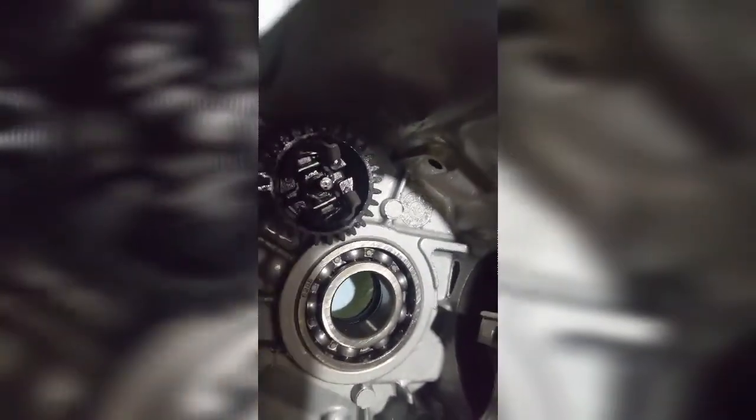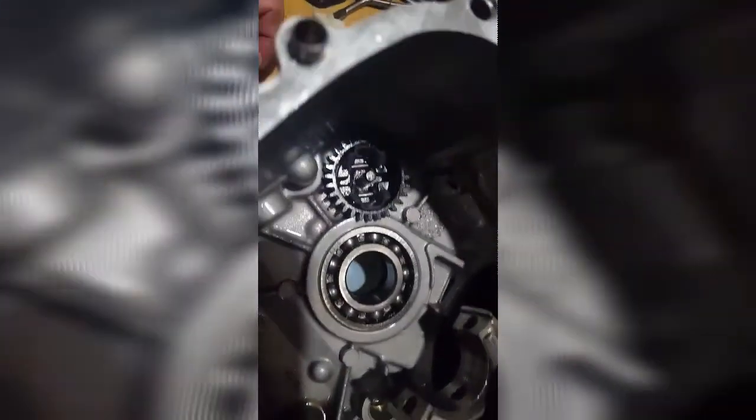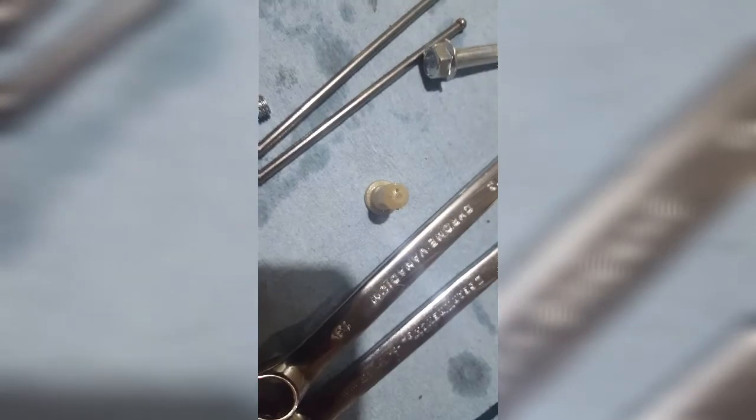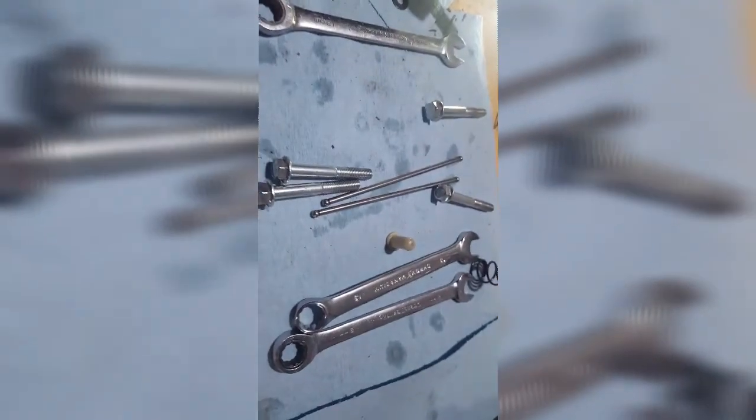Alright, so that governor, that's it right there. Good thing I took the governor apart when I did, because there was a washer hanging loose there, and this piece right there, oh thanks Ava, and I think it's recording, there it goes, sorry about that, and that piece right there was out, and then that washer was just hanging right there, so it was about to come loose and probably destroy this engine.